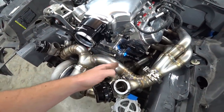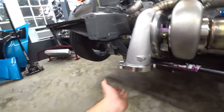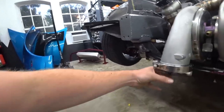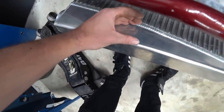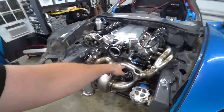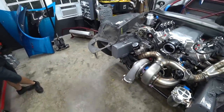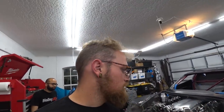My two remaining question marks: the double slip joint in the exhaust — since both sides are already welded, we don't have much leeway if it doesn't want to line up. The other question mark is coming out of the turbo into the intercooler — it doesn't make sense to route it the way it was before. Ideally we'd turn down and in, but the intercooler tank is in the way. My metal brake isn't long enough to redo this section, so I'm still unsure of how I want to handle it and how long it'll take. Other than that, everything is pretty straightforward and we're creeping toward the point where it's just lines and wiring.